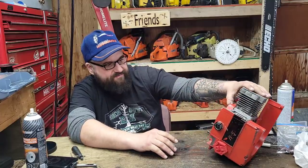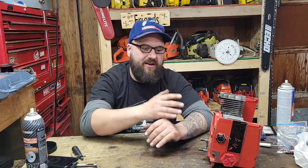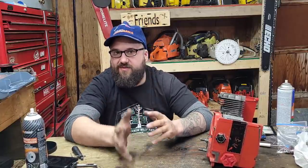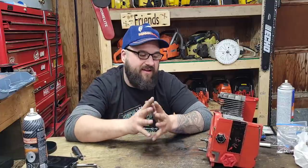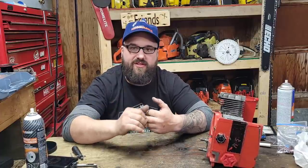I'm really excited for this one. Thanks for hanging out in the saw shop — hope you guys learned something. This applies to dirt bikes, snowmobiles, chainsaws, any two-stroke. It's not always necessary, but remember I'm increasing case capacity. More case capacity gives more upper-end power, but that could mean I need to play with the reeds or intake timing. This saw might not be as snappy as stock, so we might have to play with things to get that hit back. Buckin likes crisp throttle response — when you pull the trigger that saw lights up and he wants it to cut at higher RPM and pull the living snot out of a chain. That's what I aim for. Thanks for watching — take it easy.